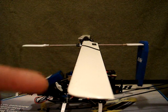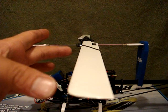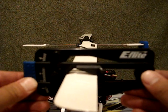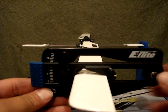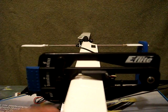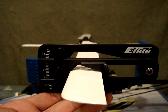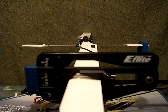I put the pitch gauge on at the first third of the blade — that's where I put mine. Some people put theirs more on, some people put it at half or all the way to the tip. The first half is probably your best choice; for me, I use the first third. I slide it on. What you're looking for to do zero pitch is I set my pitch gauge at zero pitch — it's a little line. What you're looking for is you want to line up the top of this with your fly bar. If I just raise it up, as you can see these blades are at zero pitch. It might be a little off due to tracking, but what you're trying to line up is this line with the top of your fly bar. That's zero pitch.